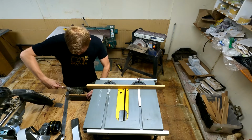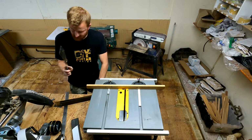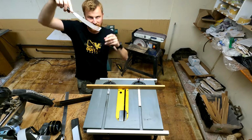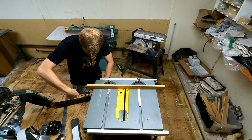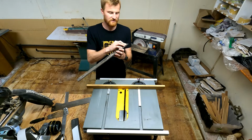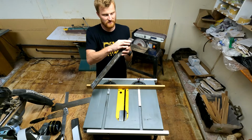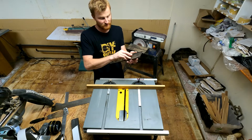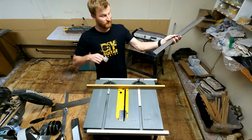All right. Let's take this. What's nice is this spatula has kind of a flex to it, just the way that shape is, so it actually helps pry as you're pushing it in. That's why I like it. All right, and then I like to get the double stick tape off of there right away, because if you leave it on there overnight or something like that, it just becomes harder to remove. But it's real easy, as you can see, to remove right now.